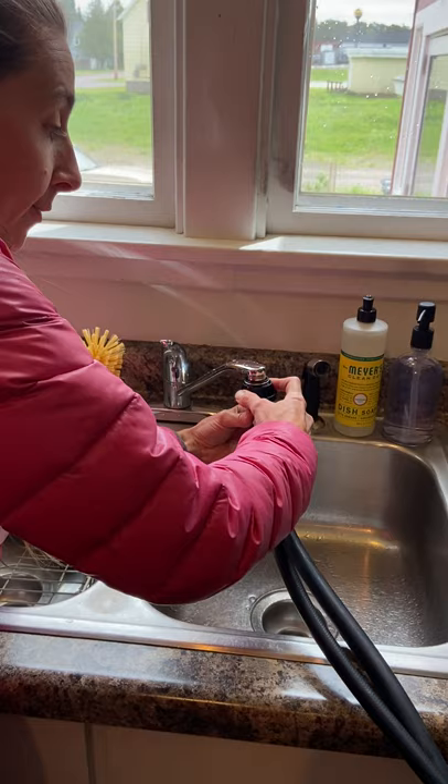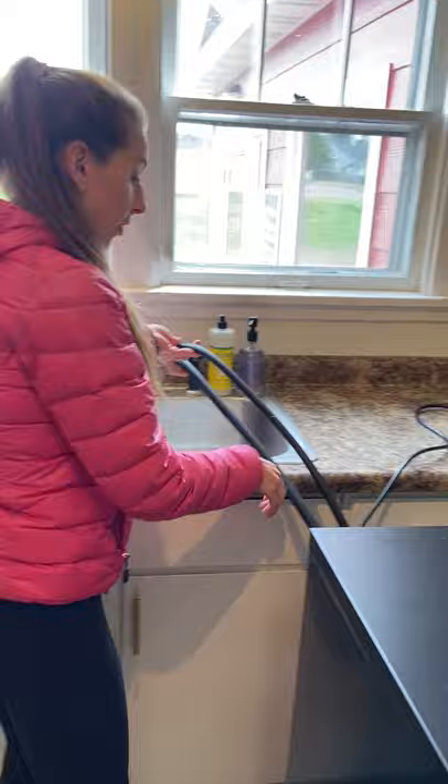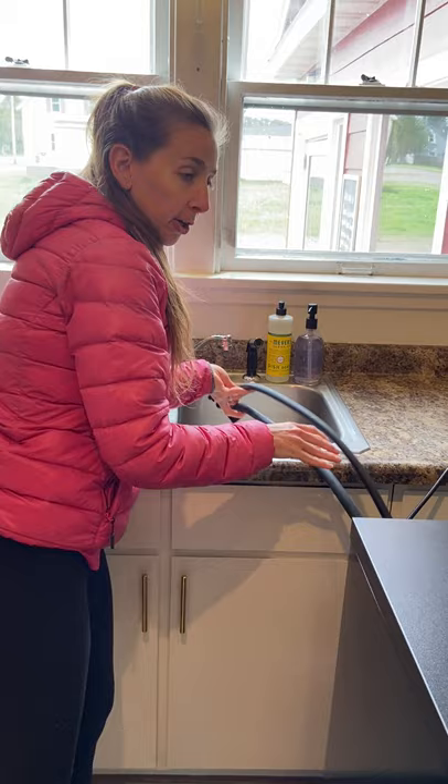Just like we put it on, hold it in one hand, press down on the flange, and pull it off. Then you can unplug it as well. Next, you want to try to get all the water out of the tube — since the tubes go above the dishwasher, take a little bowl and empty the rest of the water into it.